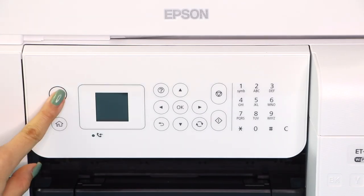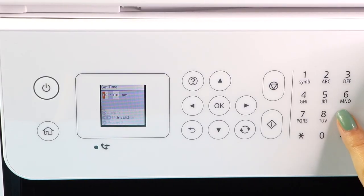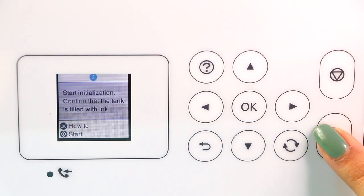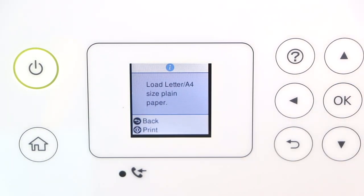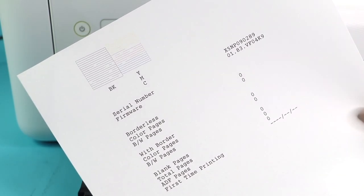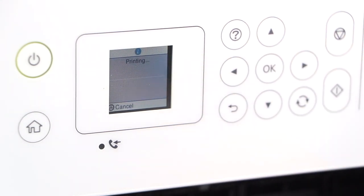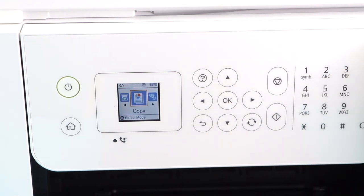Once you have finished filling up the tanks, we are ready to plug it in and set it up. When you turn your printer on it's going to ask you to fill in simple information such as your language, location, time, and date. After that, press the question mark button for 5 seconds to initiate the process, which takes about 10 minutes. It will give you the option to adjust the alignment, so I loaded my printer with regular printer paper so I don't waste any sublimation paper yet. It's going to run through a printer head nozzle check — mine was missing a few segments so I ran it through a couple more times. Lastly, it will ask if you want to set up the fax — just select no, since you don't need that feature for sublimation printing.